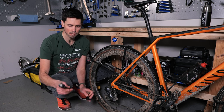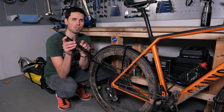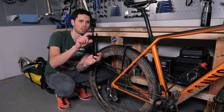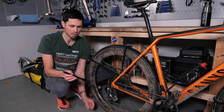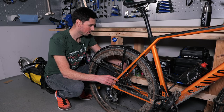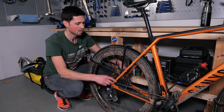Next, this axle adapter comes supplied with a number of different spacers — like what I've got installed on here, but a number more. The reason I've got these ones installed is so that I can make the overall length match up. You can see where the silver piece is — that's where the end of the axle adapter is, so I know it's not going to poke out and protrude too much farther through the frame. Once I remove this end cap, it's ready to be installed in just the same way that your normal through axle goes. Slide it through the frame, take my 6mm Allen key, and thread that in place. When it comes to torquing up the axle adapter, you need to do it exactly the same as your normal through axle — in most cases around 15Nm.